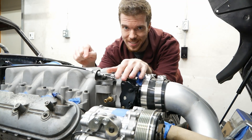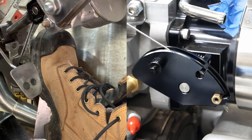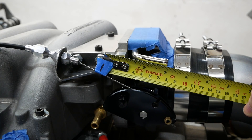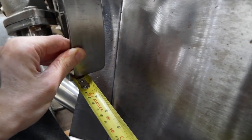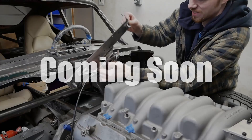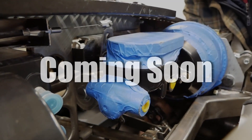The pedal ratio is quite important in this design then. And although a cam lobe can still be used to alter the linearity of response, it's not adjustable on the fly. So in terms of calculating the correct ratio to use, we just need to account for the distance the throttle needs to open versus how much we want to move our foot. Keeping things easy, we've gone with two and a half inches on both ends, but you'll notice that's not a one-to-one pedal. As always, we've run out of room on this car, so things have got a bit complicated, to say the least. But more on that in the next build episode.